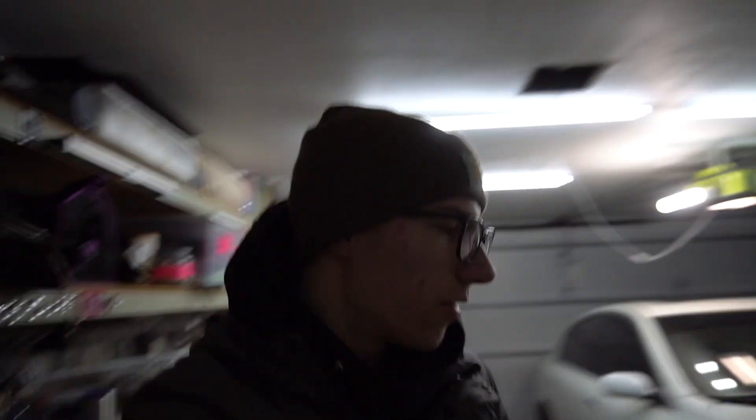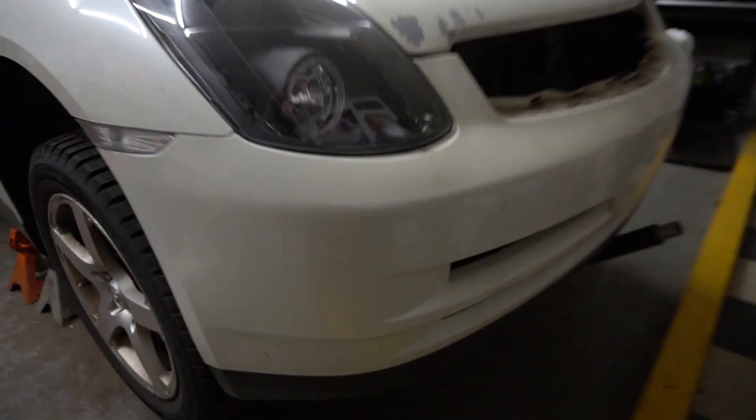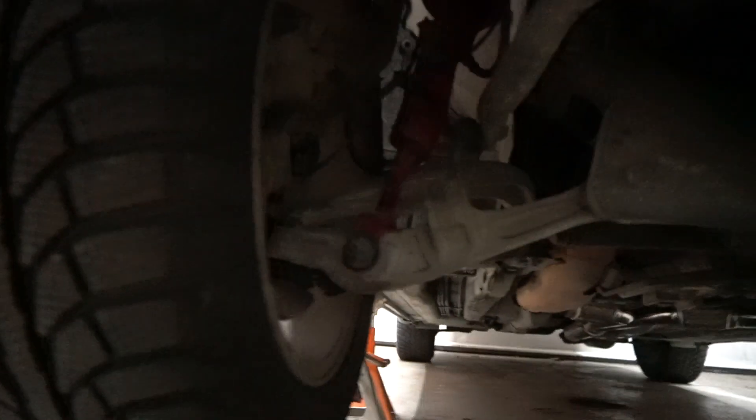Can't start it up right now because I still have to replace the valve covers and stuff. Another thing I need to do on this is put new ball joints in — the boots on both sides are looking a little bit worn out. While I've got it in here I may as well replace those. I'm going to take the wheels off and see how far we get tonight, probably finish it up tomorrow.